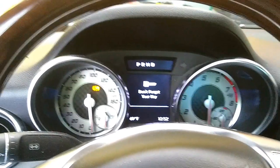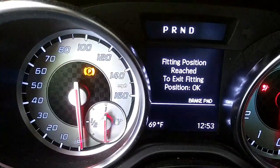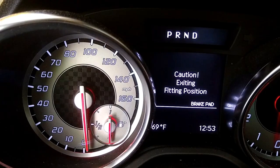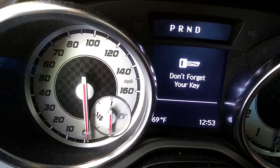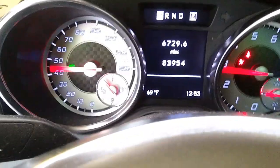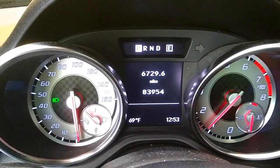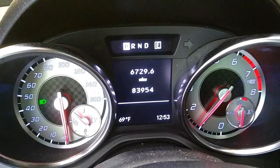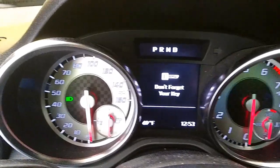We're back in the car. Press to the first position — it comes up with 'Fitting Position: press OK to exit.' Press OK and it will exit. Press OK again, then turn the car all the way off. Now start the car, give it a second, and hopefully the brake pad wear indicator message is not there. It normally would have come up by now, so we're good to go.